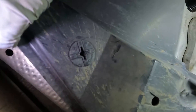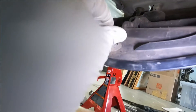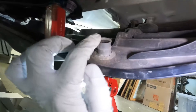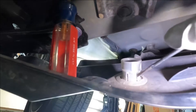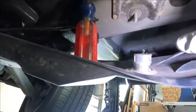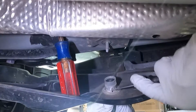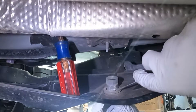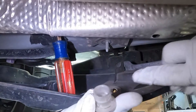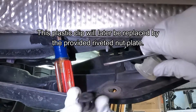Once you have this free or the splash shield down a little bit, come over here. On the splash shield — I just have it propped down with my screwdriver — we just need to pry out these little tabs on this little white clip, and that will separate it from the black part. They give really good instructions showing how to do this. See this tab right here? Just need to pry that out. It says to use a pick tool, but I'm just using a little flathead screwdriver. You've got to pry that tab all the way out. These little plastic tabs — you just need to pry them out and then you can pull out the center part.